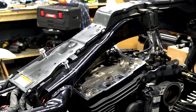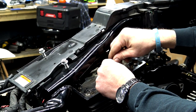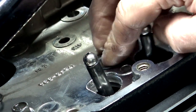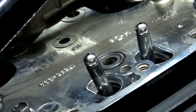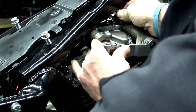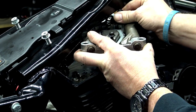From this side, he's going to go ahead and drop the push rods in. The long one goes to the rear — that's your exhaust cylinder — and the shorter one goes to the front or middle. When you do the front, it's just the same: the short one goes in the middle, the longest one goes towards the very front. Take your new O-ring and set it down in here underneath the rocker arm support plate. Once you get that in, lay the rocker arm support plate in. You want to leave the rear two bolts in the plate because once it's set in there, there's no way to get those bolts in. So take your time, leave the bolts in the rocker arm support plate, jimmy this thing around, and you'll get it to set in.